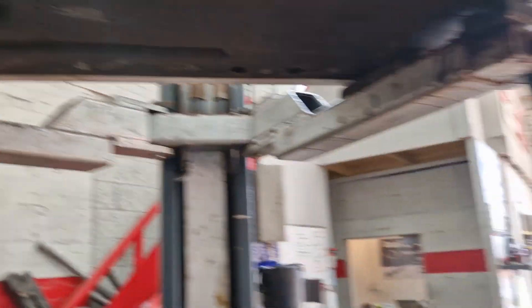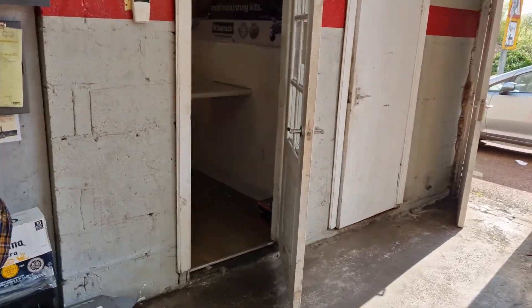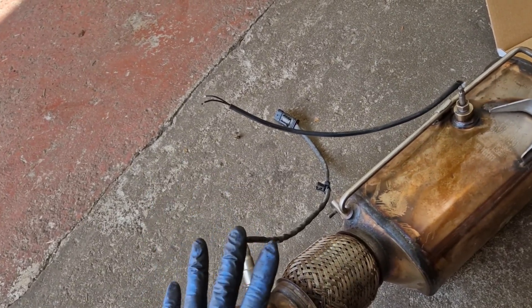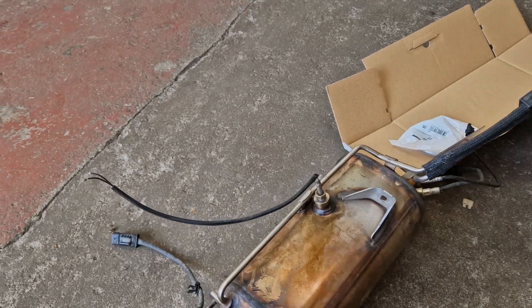Anyway, we'll go back onto exhaust. Obviously the engine moves as you're accelerating. So what happens if we weld in a flexi part and then weld a steel bar from there to there? We've then done away with the flexibility. So what's going to happen? Something's going to give. And in this instance what's happened is it's broken right there. The guy that welded that in there has 100% cost this guy that DPF.